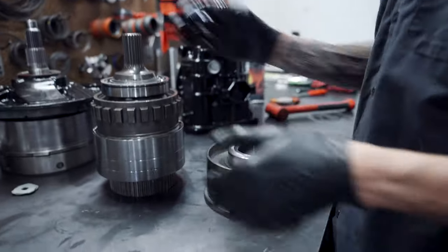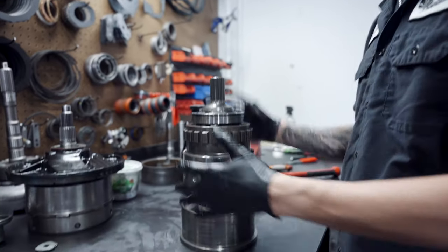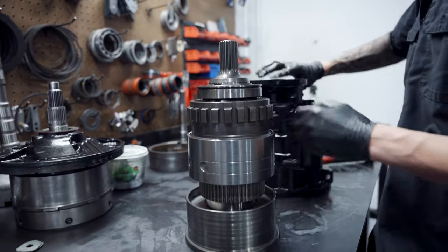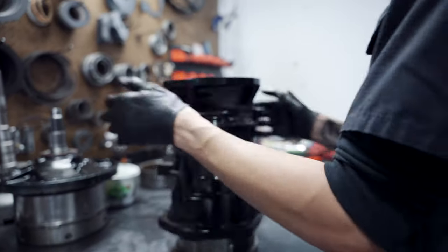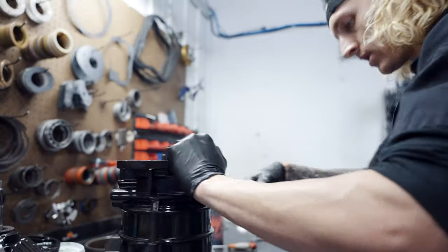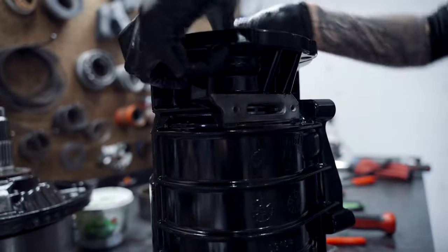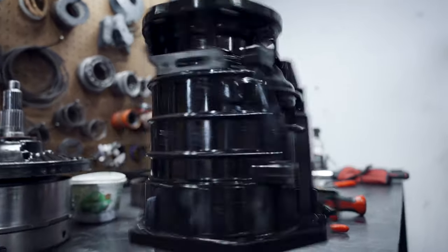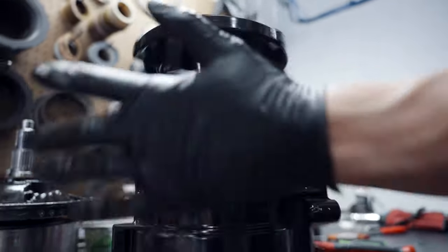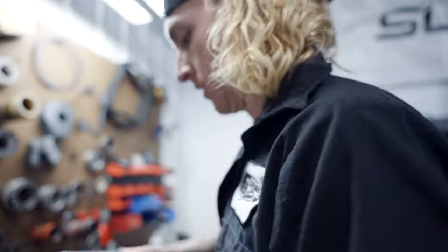Take the shim out. Put this right here. It's a little cheap way I have to do it. Some of my buddies that build transmissions have a hole in their table. Take this, a little spin. All right. As you can see, I just bought the snap rings. The snap ring was a little pushed over to the side. But essentially, this is riding on the bearing right now, which is good. That's what you want. So now we'll stop that. Put this upside down, and over.